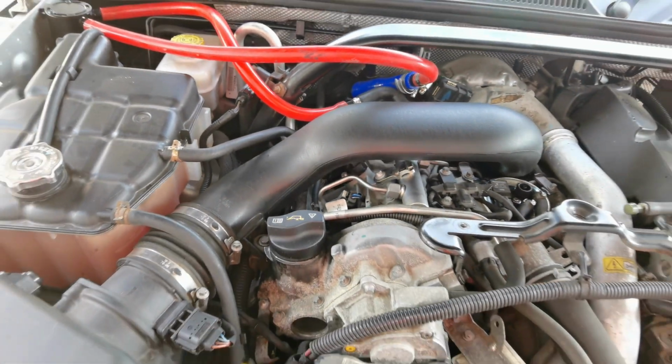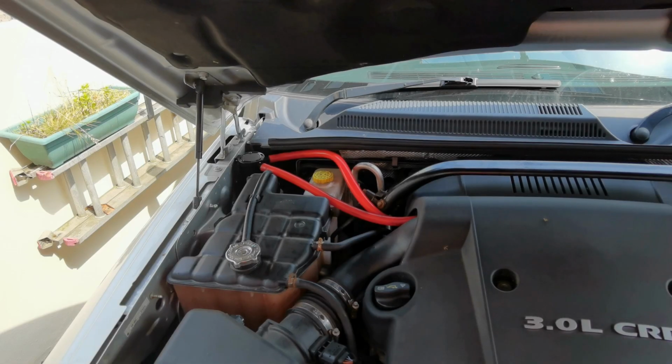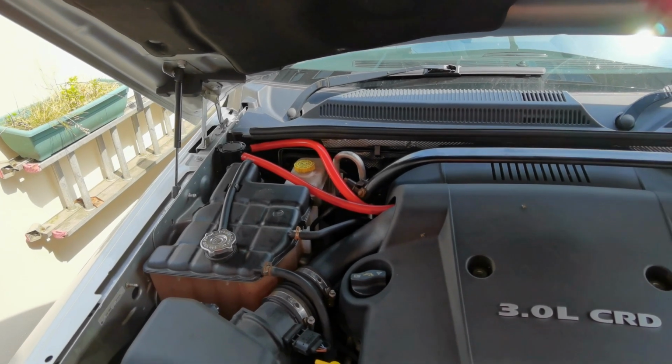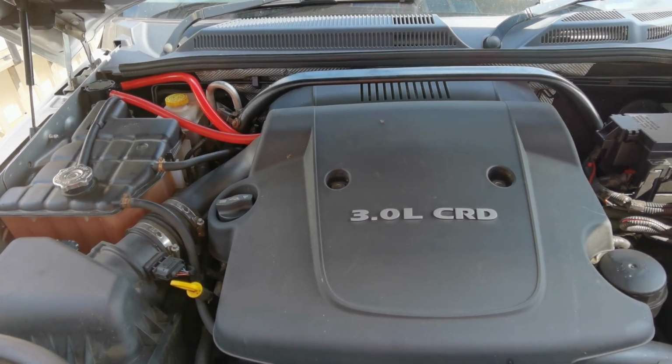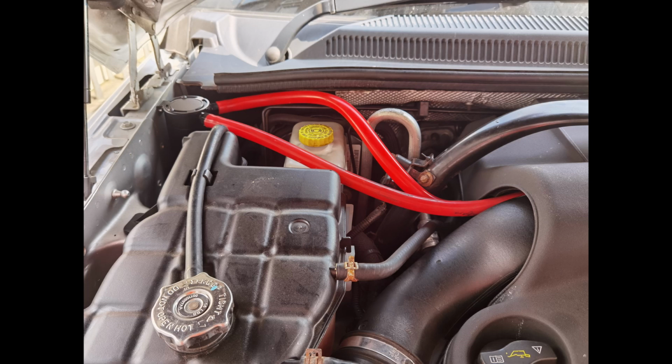I drive the car for a week and then scan the ECU to see if any codes pop up. If they don't, then drive it for another 3 weeks and then try emptying the catch can. You should have oil in there that would have otherwise gone into the engine.